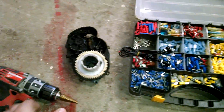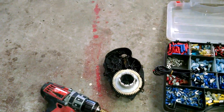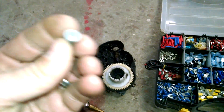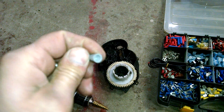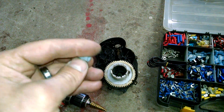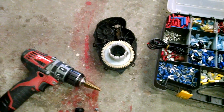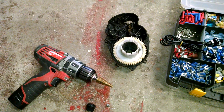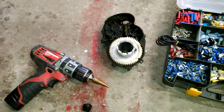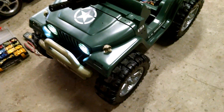This is just basics, not an in-depth how-to. For light connections, a lot of times if you have to take the vehicle back apart, we don't use crimps because then we waste them. We use these little tiny wire nuts — if they're good enough for residential wiring, they're good enough for us. They hold up to three or four wires. We twist those on and run some really good electrical tape over it — not cheap dollar store vinyl stuff; we use Scotch Plus 33.